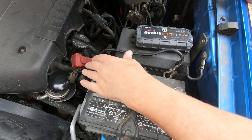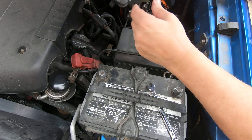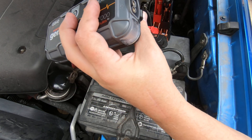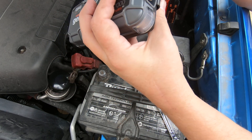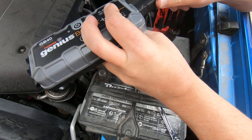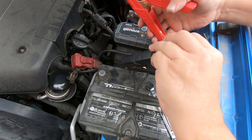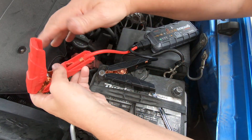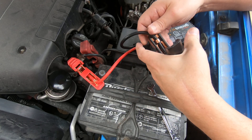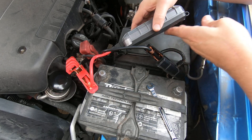I've disconnected the battery completely — negative and positive cables. I've also pulled the fuel pump relay so the vehicle will not start. My plan is to get this hooked up and crank for about five seconds, stop, then do five seconds again — three times total. Since this has a puffed battery and it's eight years and two months old, I don't know if this is actually going to do it.